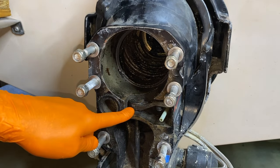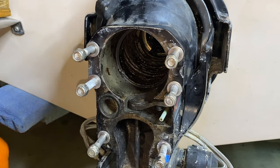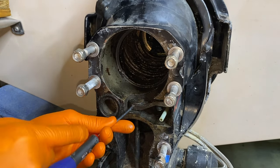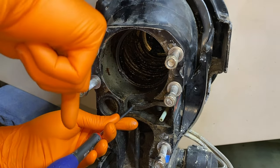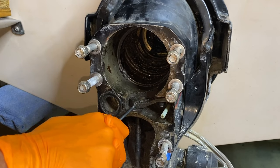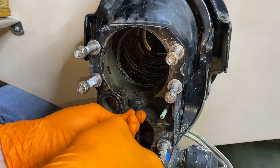You may need to spray this with PB Blaster. Be very careful — if your U-joint bellows failed and allowed water inside the cavity, you might have corrosion and rust in here. Ours looks pretty decent and well greased, so there wasn't too much water in this area. Do your best not to strip this as you remove it. If you're having trouble, grab a hammer and carefully tap the base end of your screwdriver while simultaneously turning counterclockwise to loosen.